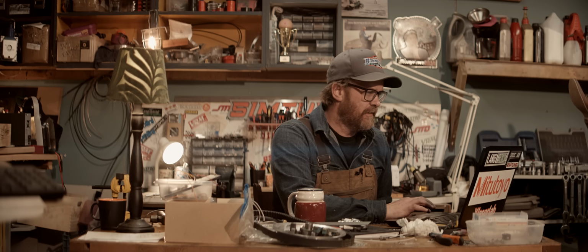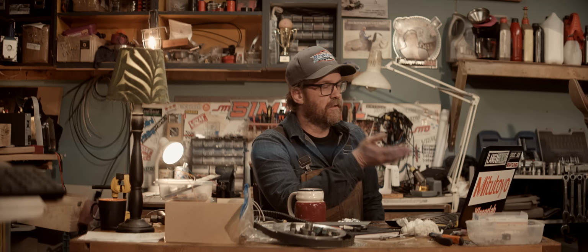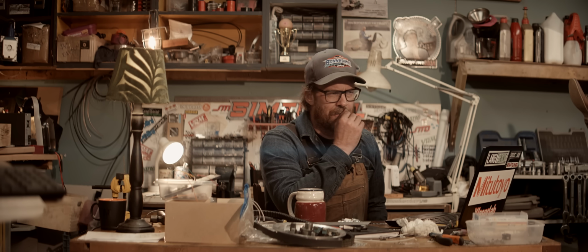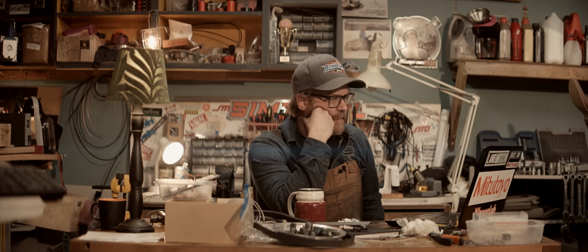I'm not sure if we gained anything. And this time too, I lost one run. Something weird going on. Anyways, we saw 26.6, we saw 26.09 and 26.6 horsepower at slightly higher RPM than the previous run, the pink-purple run, that's before we switched to the chain and sprocket drive. What's interesting is how adding 5 more degrees of ignition timing at peak power didn't affect things much, and it affected things in a weird way where we gained more RPM, it seems, and that doesn't make sense. Usually it's the other way around. If you pull out timing, it'll rev higher. I'm not sure what's up with that.